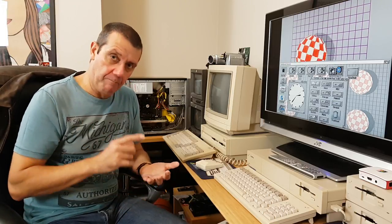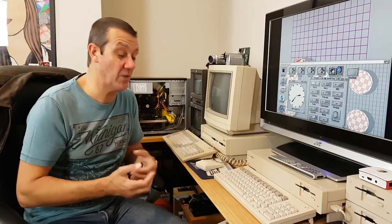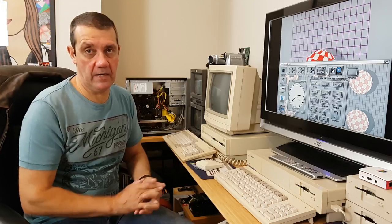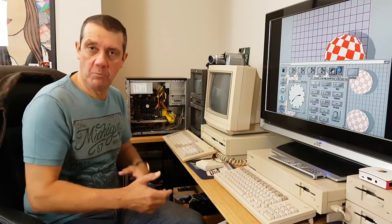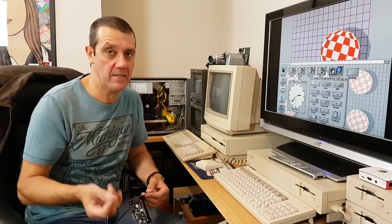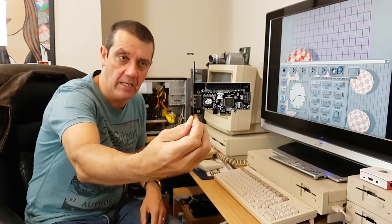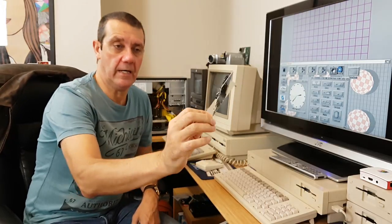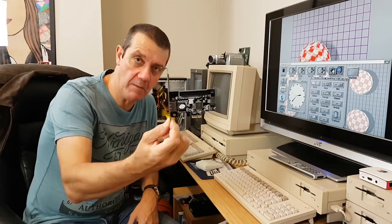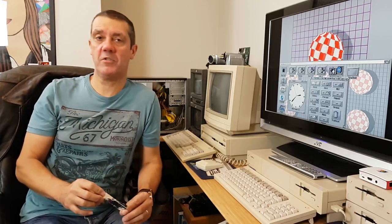It's a pain, but hopefully we can get some SATA drivers written — it's quite a complex subject. However, you can get around this if you've got an IDE/ATA connector on your motherboard. If you haven't, I bought this little card that goes into a PCIe x1 slot. It's got a SATA port we don't need, but importantly it also has an ATA/IDE port on it.